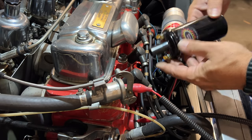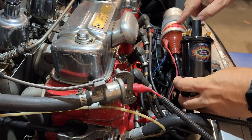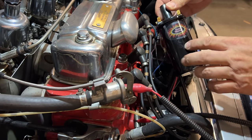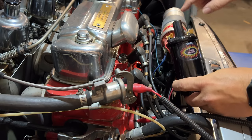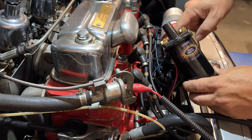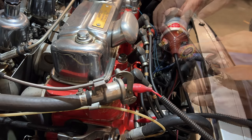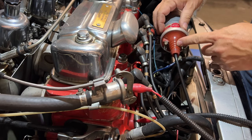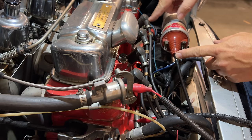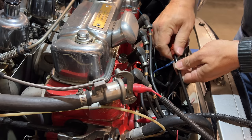The next change I'm going to make is putting in a Flamethrower coil. I will be replacing the Lucas Sport coil with a brand new Flamethrower, just to make the car a little more reliable, because who knows how old this coil is. This is an easy swap — just swap the wires straight over from this coil to the new one and put the Flamethrower coil in the clamp. This coil uses a screw-in type HT lead, and I was going to replace the HT leads anyway, so I will be replacing it with a type that works with the Pertronix coil.